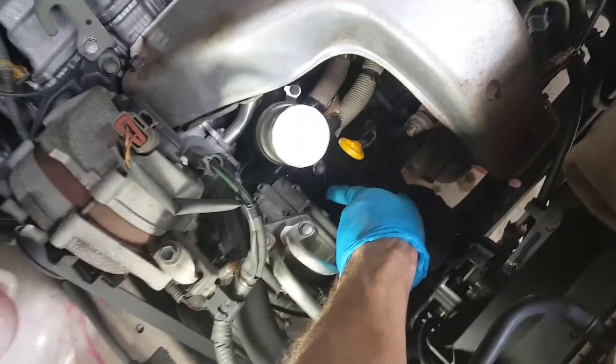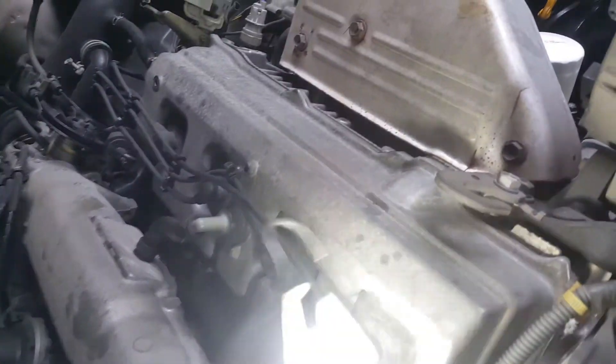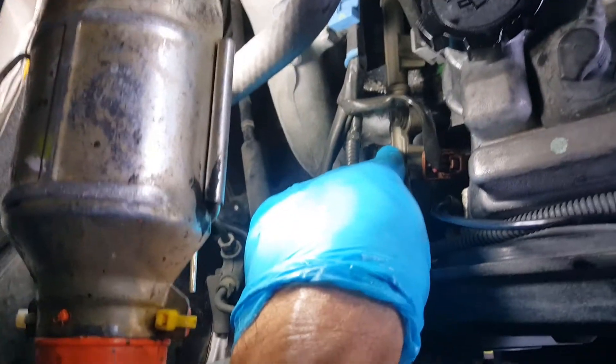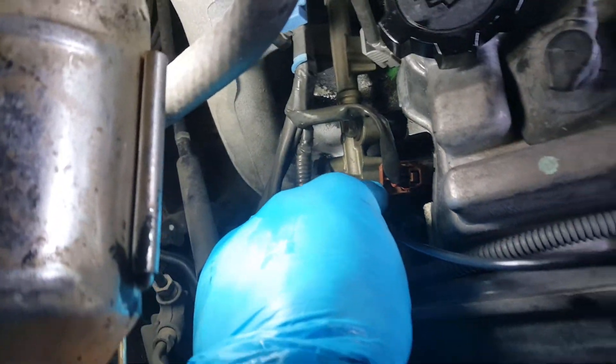A bit of oil did get on here even with the oil protection I built, so I cleaned it up with some degreaser. Also, be careful when tipping oil back into the engine - it can drip down behind here and lodge in the inlet manifold just down there, where there's nowhere for it to drain. There's the injector there, so just be careful of that.